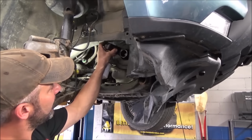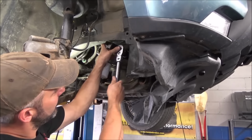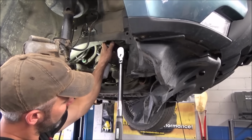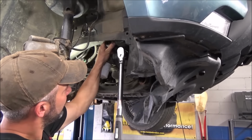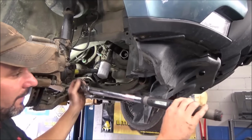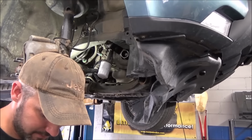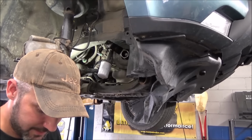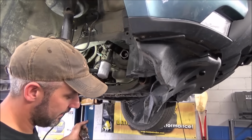So this is where the crankshaft holding tool comes in handy. Try to get it in here wedged up against the body, hopefully. We're going to do our, if this thing will hold. So there's our 47 foot-pounds, 46.6. I'm going to recalibrate my torque wrench here for doing degrees. Gotta let it sit steady, and then we're gonna do an additional 60 degrees, hopefully, without this thing flying apart.